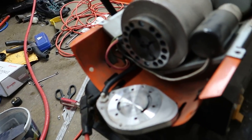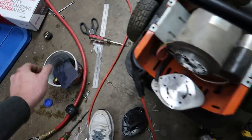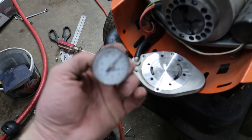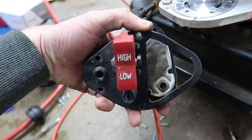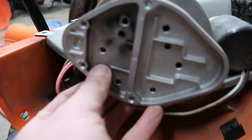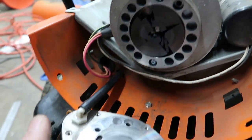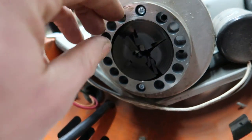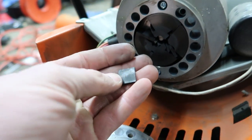So what you have to do is remove this. You take off the gauge to remove this. This thing right here you have to remove to get to a couple of the screws. Then you're going to take out four screws to remove this, and there's also a filter in there you probably want to clean. After that, you're going to take off all those screws that hold this on — there's quite a few of them, but it was pretty quick with my impact. And then as you can see, there's this fan that blows the air so you can get in your fuel, and this thing is all cracked and broken up, as you can see.